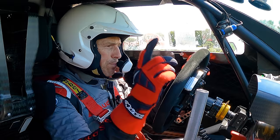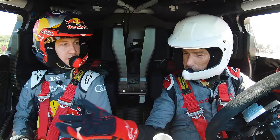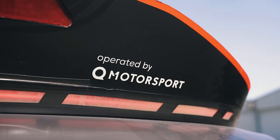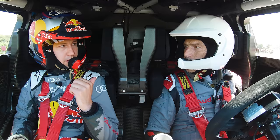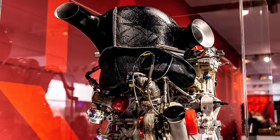I've got Emma Burquist with me - she's the co-driver in the racing. So can you explain a bit about this vehicle? It's a bit of a special car. We have one electric motor in the front, one electric motor in the rear, and then we also have a combustion engine on board for charging the battery, because we could not pull a big charging cable in the desert.